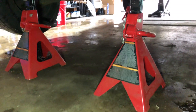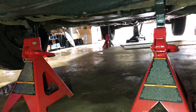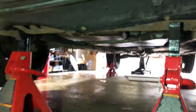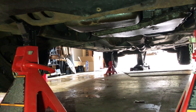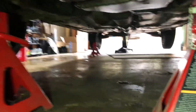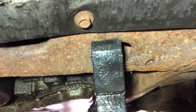In the front I have my two larger jack stands. A car is roughly maybe 4,000 pounds on the heavy side, so even three-ton jack stands are fine — mine hold 6,000 pounds. What you want to do is find a part of the frame that can have some surface rust, because it's still much stronger steel and it's part of the frame holding the whole car together. Find a solid spot and get your jack stand set underneath it as close to the metal as you can.